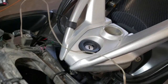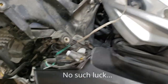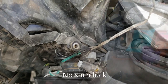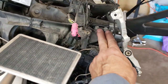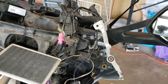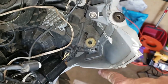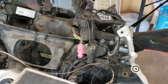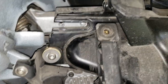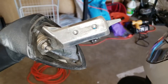The next thing I'm going to do is take the handlebars off — I believe that is a 22 millimeter nut, and that may just give me access. I think the next step is to release these two bolts on each side, which will let me slide the mirror out, and then I can come through and remove some mounting bolts along through here and maybe take these pieces off. That will let me get the headlight out. With those two bolts out, the mirror assembly just pulls right out.